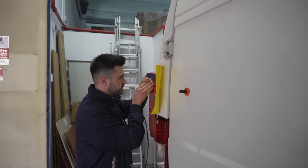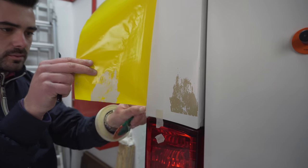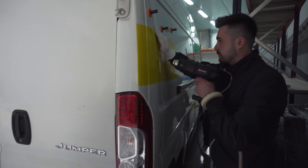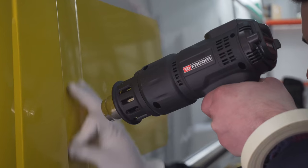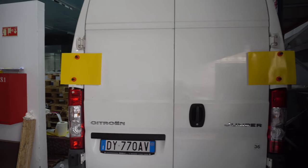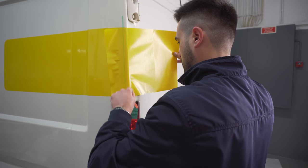Our van is 10 years old and most probably had some painting issues from the factory — I saw the same problem on other vans. Obviously you do everything from both sides. Sometimes on tricky corners you might need to stretch the adhesive material, and a heat gun might help. But it won't do miracles — after we finished the job we still had a gap on that corner. Here is how we solved the paint problem by putting a new piece of film on it.